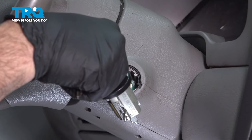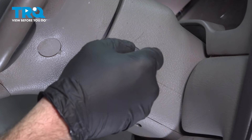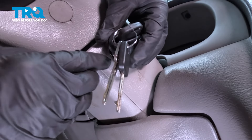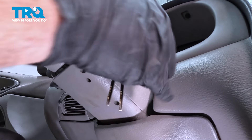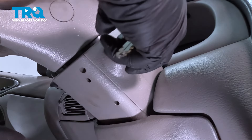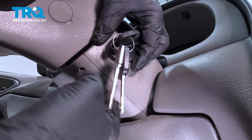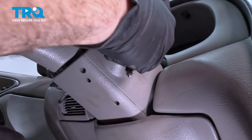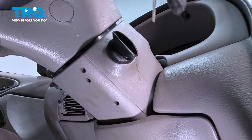Take the new cylinder with the key in it and make sure it is lined up with that little button face on the bottom. To get that to pop in, turn the key back just a tiny bit and continue to work this in. Push it in all the way until the ignition cylinder is locked into place — you're going to feel it seated all the way up against the steering column. Try to pull it out and it's locked in. At this point, you can turn the key back and pull the key out.